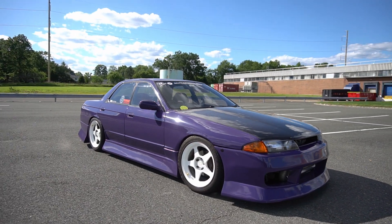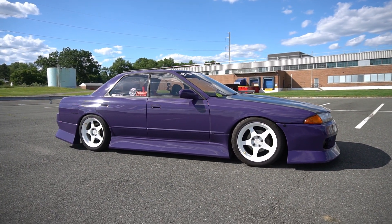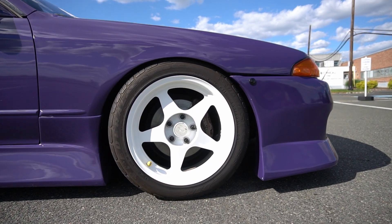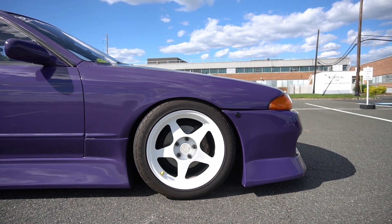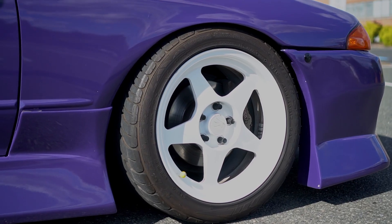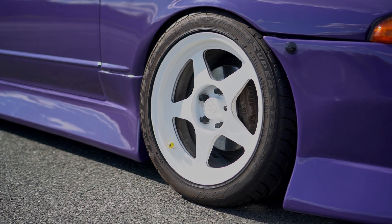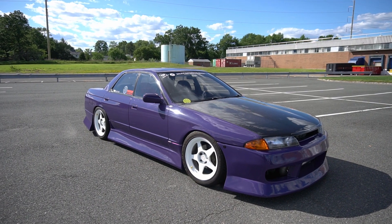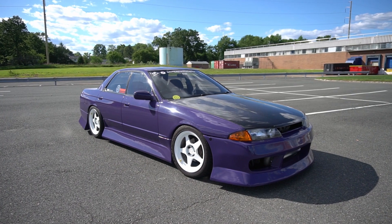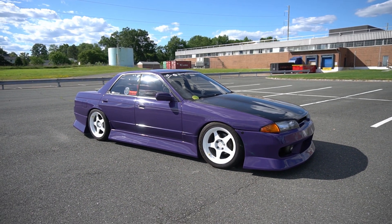I changed up the wheels. I've actually had these wheels for quite some time — I got them for a good deal, actually before I got the car. They're my favorite wheels: Rig-Master Marquis-Promads, along with the Moon Eyes caps. They're 17 by 9 plus 38, square setup, with Federal RSR 255/40/17s.